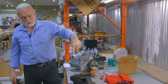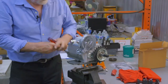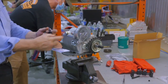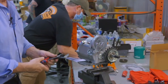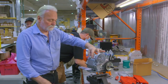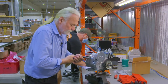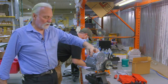Now, our detent plug, you see here, you notice I haven't locked the tangs. We're set into position here for locking. Your large ears on your detent plug must form to the housing. Keep this from backing off, especially once this is installed in the motorcycle itself. That's in a tough location to get at later. So we're locked into position here. We'll draw the large ears back against the housing itself. Set my channel locks. Come in. And roll against the housing itself. Neat and clean, one clean shot.